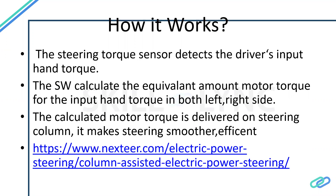This data is then transferred to the Electronic Control Unit — the brain of the system — via protocols, wire, or whatever it is. The code already available in the ECU will calculate the input torque, how much the vehicle is traveling in terms of speed, and other related inputs. It will then request the motor to generate the required amount of torque, which is converted to a corresponding current given to the motor, and the motor will generate the torque.